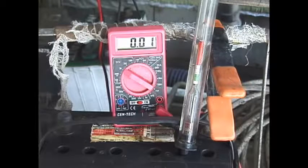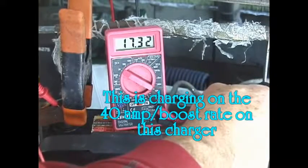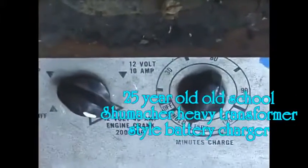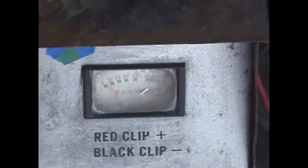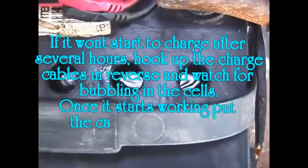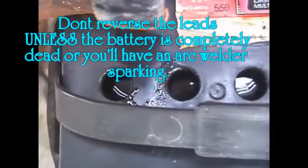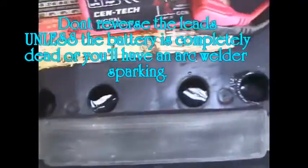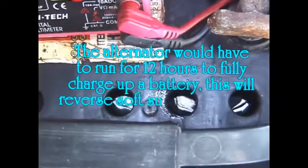Look for cracked cases or bulged cases, indicating the sulfation has pushed the plates out and deformed them. Pop the caps off the top of the battery and examine the electrolyte levels. If the water is low, add distilled water to at least a quarter inch above the lead plates. The voltmeter is running at 17.32 volts — put it on the 40 amp boost rate, which is why it's so high, and it's only running at about 4 amps at this point. You can see it's starting to equalize and boil the electrolyte. Some of the cells are not doing anything and others are starting to function. A lot of times it will take hours and hours before you can get it going.